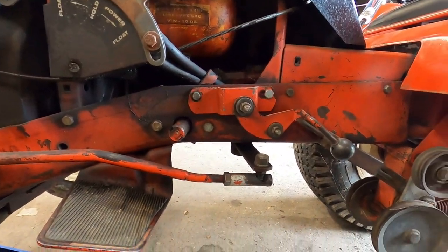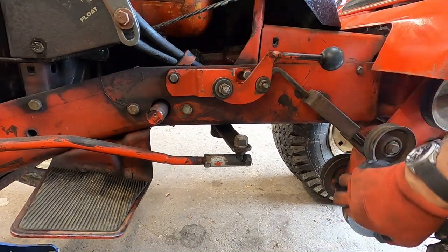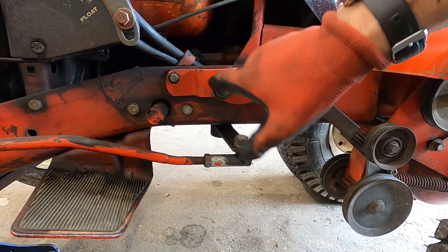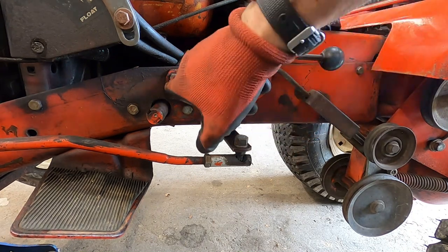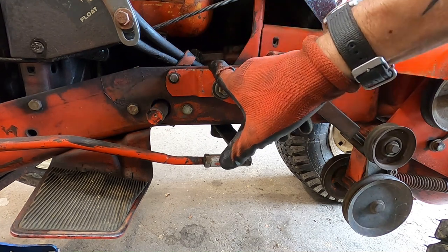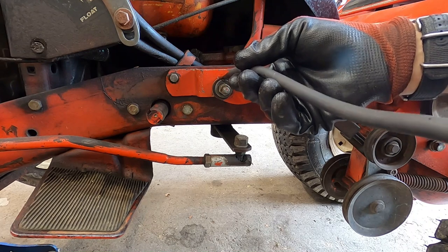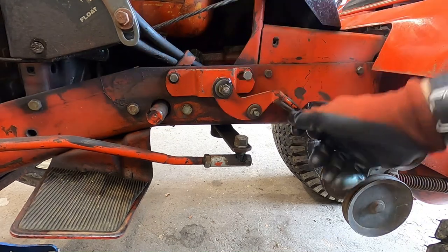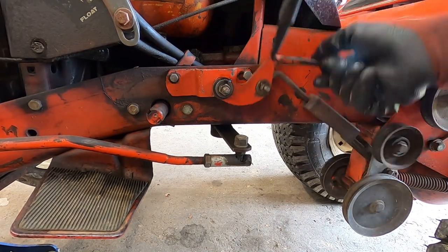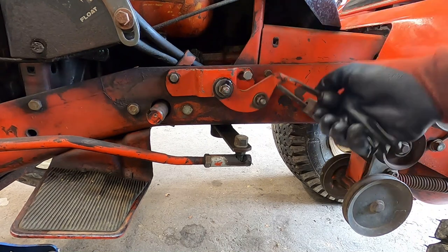Working back left and right — over here we have the mid PTO. The mid PTO has a number of lubricating points. Your shift quadrant will still have this pivot point; this is just a hydrolift plate that takes the place of the strong arm shift quadrant. A little bit of oil on both sides, then work it to spread the oil out. Same thing here — a little oil on the outside, a little on the inside, just a drop or two.